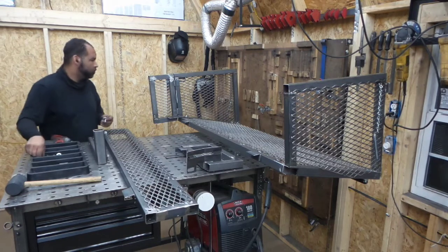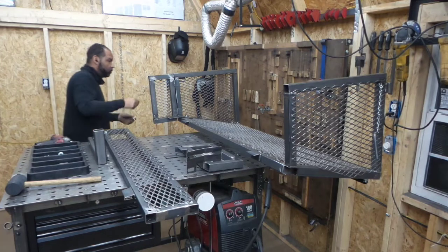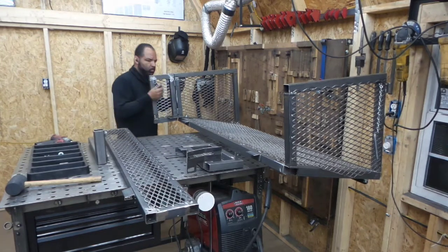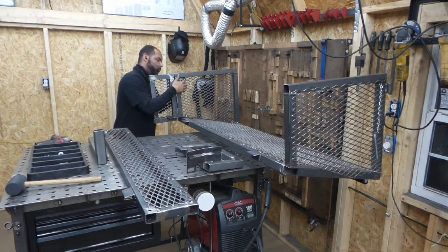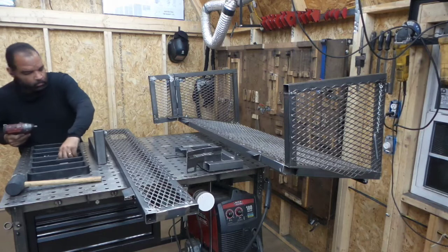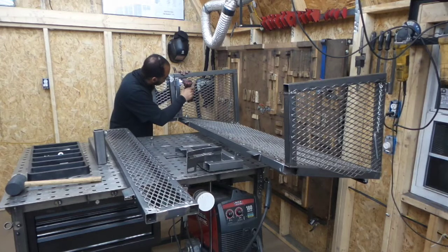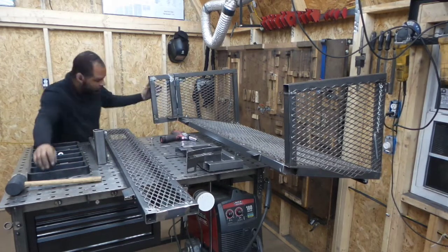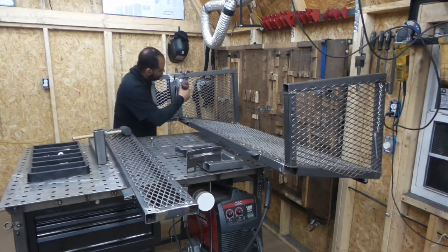I can't really go much farther than 8 inches as far as a flat extension is concerned. The 24-inch dovetail option I offer — if you buy it with that option — is going to need some extra supports to connect to the truck, because the only connection point for my ramp is the hitch. The longer that span is, the more possibility there is for flex and weakness, so on the 24-inch I'll be adding extra supports, but it'll come with it when you order it on the site.